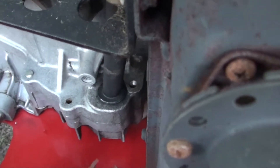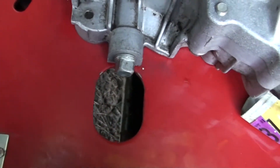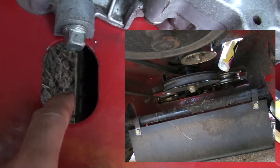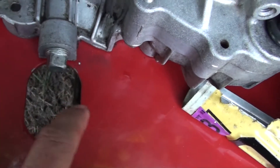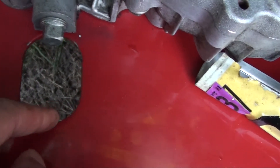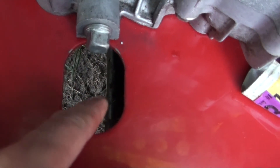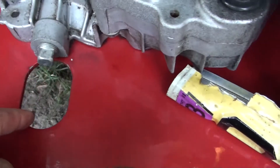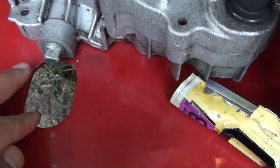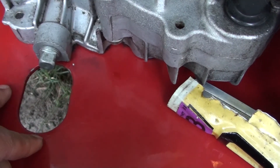There's another thing you'll notice about this mower — looking down in there, you can kind of see there's a black flap right there. If you don't have the deflector, what happens is sometimes the oil falls on the flap and then actually drips down onto the ground. When you do the oil change, make sure you have concrete or asphalt — do not do it on grass. That's just something I do normally.